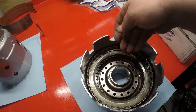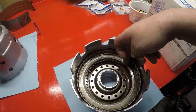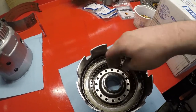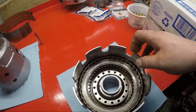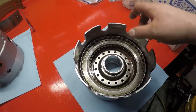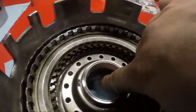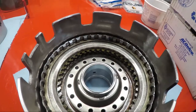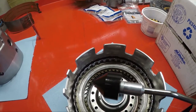So when you apply, between your wave plate or apply plate and the piston, it's going to leak — that's supposed to be that way — but you want to make sure that the clutches apply tight. So I'm going to try to get the camera in a good position, and your apply hole for this one is right there. We're going to use our medium tip to get it to seal.